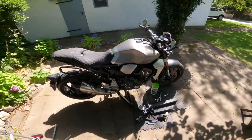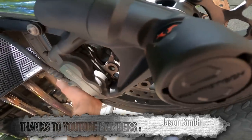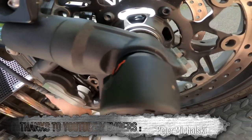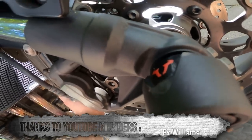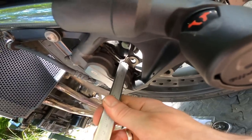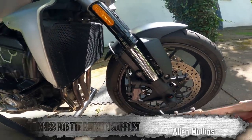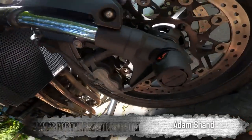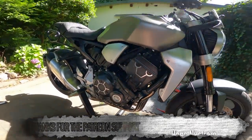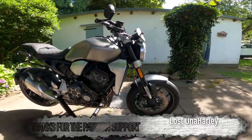There's not a great deal left now. One thing I need to do, which I've already done at the back, is check the front brake pads. I think they're still going to be good - I've got about one and a half millimetres left to the wear indicator. These pads come with about four and a half to five millimetres of meat, and measuring from the edge I've got three and a half millimetres there. That's plenty - these are the same pads I've had on since I bought the bike 20,000 kilometres ago. That's going to be plenty enough for a 4,000 kilometre tour. Plus in Norway we're not exactly going to be breaking speed limits - the fines are insane. It's just going to be a nice, relaxed, scenic, twisty, super beautiful ride.